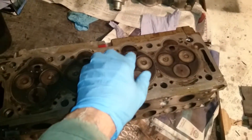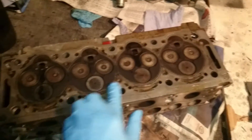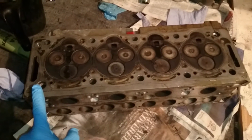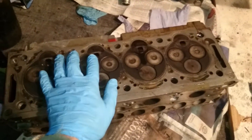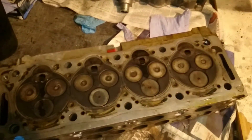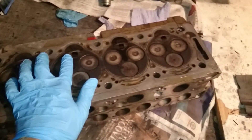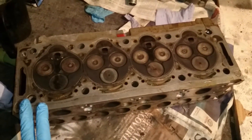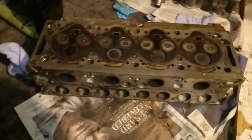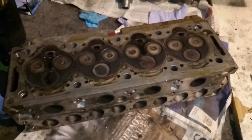They'll take the pre-cup out, put it back in the right place, press it in, and then they'll skim it. They'll have to use a grindstone for that and do it correctly, because these pre-cups are made of a very, very hard material, and this is just an alloy, so they have to do it in a different way than you'd normally do with perhaps a petrol head or a direct injection head.